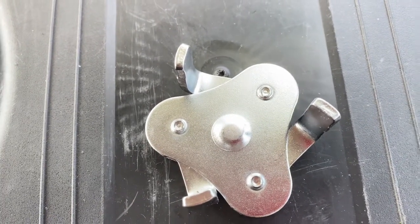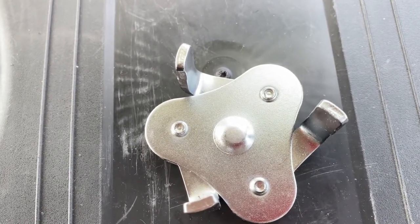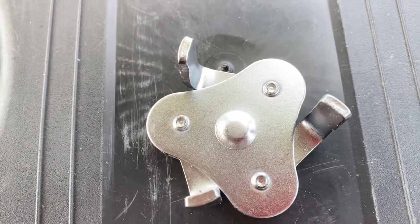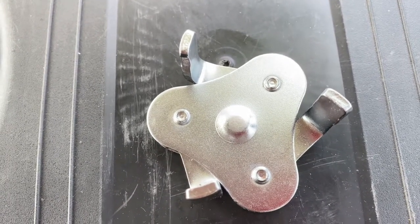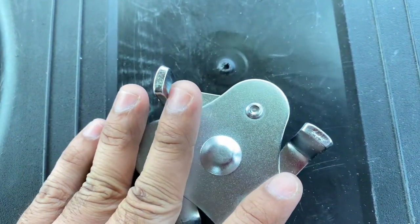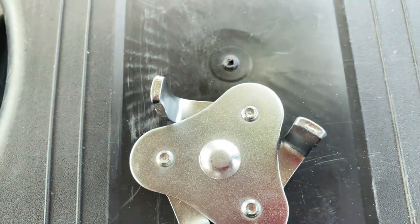If the filter is below the engine, simple jacking is enough, or sometimes you can remove it just by hand. You need to find where the filter is, and if it's easy and convenient for you, you can change it by yourself. One very important thing to be careful about: this tool is okay for removing the filter, but when adding the new filter, never use this tool.